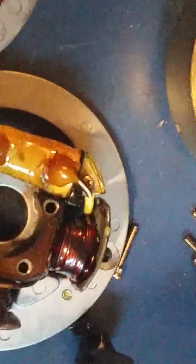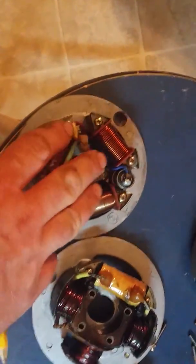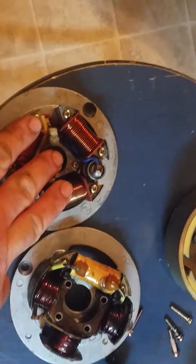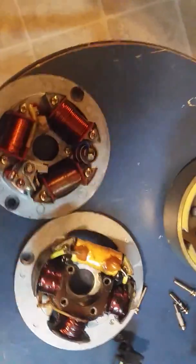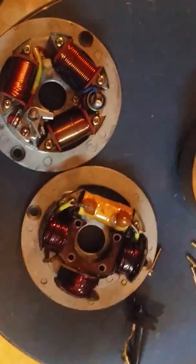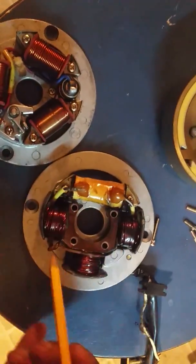I don't know the exact size — I know they're fine thread and I think they're 2 or 3 millimeter; you'll want to measure them at the hardware store and buy the correct tap. On this setup I used the Yamaha Moto4 charging system and was able to get 14.5 volts out of it when all was said and done. I showed it in a previous video — the motor was running rough so it read around 13 volts, but it was charging well over 12. That coil will fit right here; all you have to do is drill and tap it.